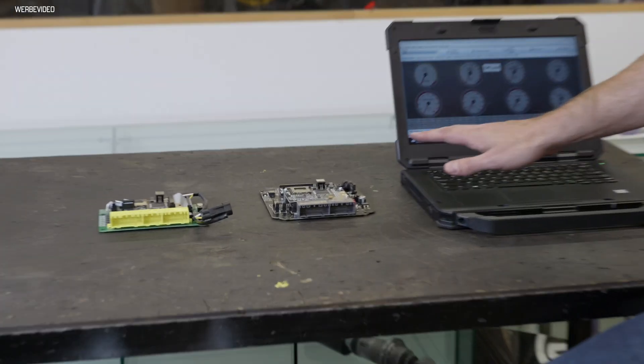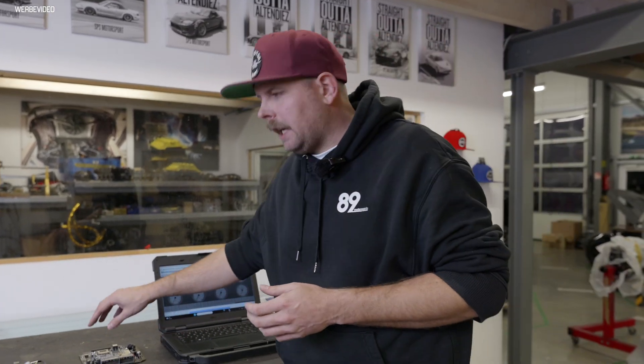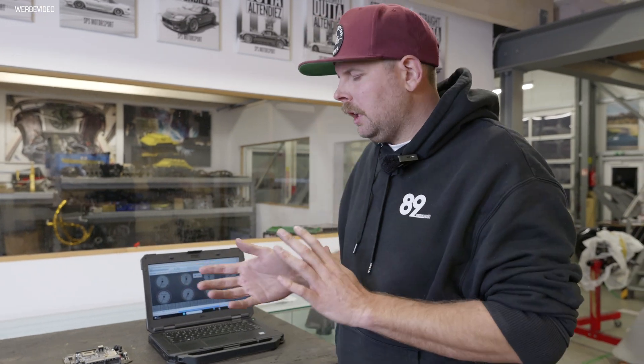So he made for us the Mini Plus — that's what we call it. It's actually a Mini but with a little plus. The plus means it comes with all the idle control strategies, and we have an internal wideband controller built in. You don't need an external AEM wideband anymore — you just need the LSU 4.9 sensor from Bosch. Use that one generally, as all other sensors are not working. It's fully controlled by the ECU, so we can control the heat strategies and ensure a long lifetime for the lambda control, just like a stock ECU does.